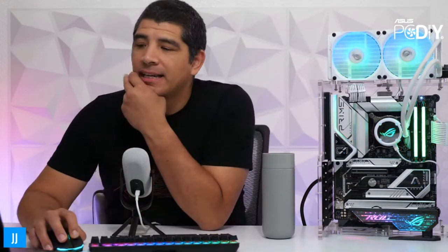140 millimeter fans. Yeah, we've had some feedback on that. The reality is that 140 millimeter fans don't really have that much justification, I think. The reality is that 120 millimeter has been so highly optimized in terms of static pressure, performance, choice selection, and mechanical interoperability that I think it's really where the lion's share of the market is. 140 millimeter is a little bit more niche. You have started to finally get much better chassis support that allows for 140 millimeter fans, and it is something we are evaluating.